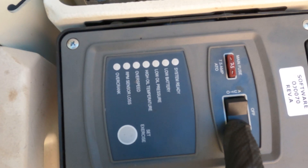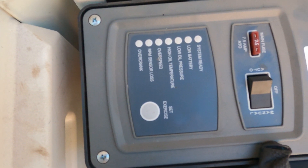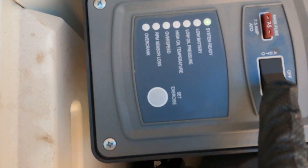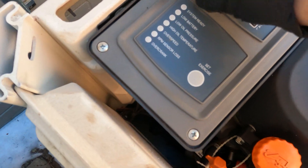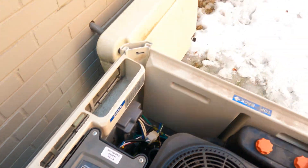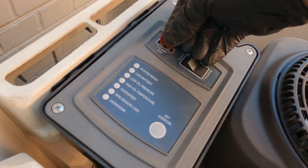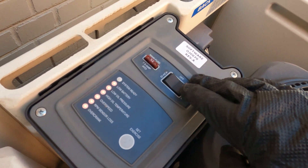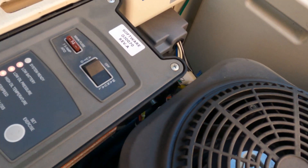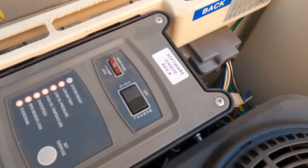So we see the screen is just in the off position. I think the customer tried to put it on manual and auto — it didn't work and they called us to check it out. I'm pushing it on manual. I can hear it's not cranking; it tries to crank but it didn't work. I check the fuse — fuse is okay. I put back the fuse and check it back to manual. It doesn't work, just flashing all the lights, which means it doesn't crank.